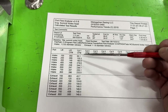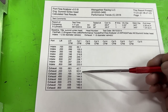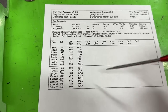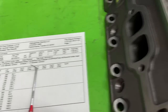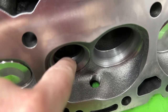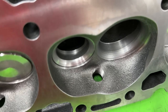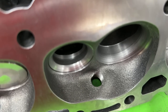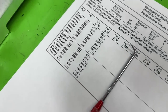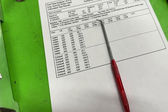On exhaust, what you see here is almost the same as what a stock Vortec flows for exhaust. And that's largely due to this step — I'm going to try again to capture it on camera. See that step? That's left there for machining where they cut in the seat, but it kills valve flow. If you got rid of that step, it would easily go probably 160 to 180. So that's the reason why exhaust is lower. But that's still about the same flow as the stock Vortec exhaust.